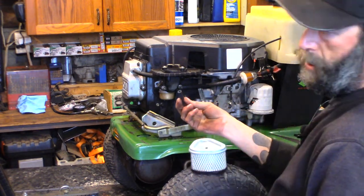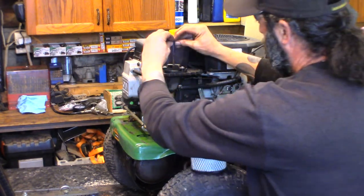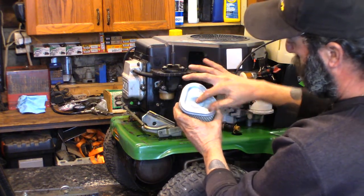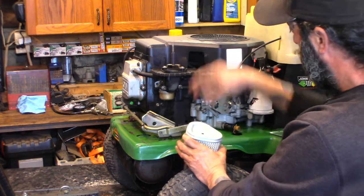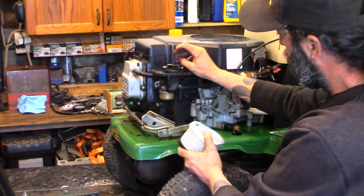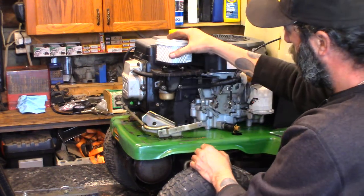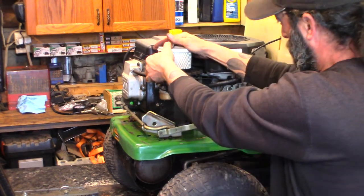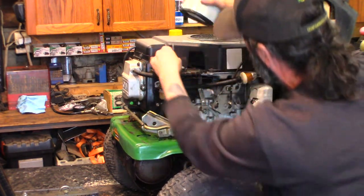These come with a little tiny piece of rubber hose. That's supposed to go in here. It does two things. First, it helps stop this from collapsing when you run it down with a wing nut. Second, it creates a seal. The top of this rubber pushes on here and keeps water from dripping straight down that tube in case you get some water. This one, I think I'm going to have to trim this rubber down.